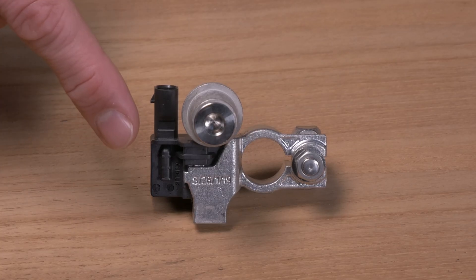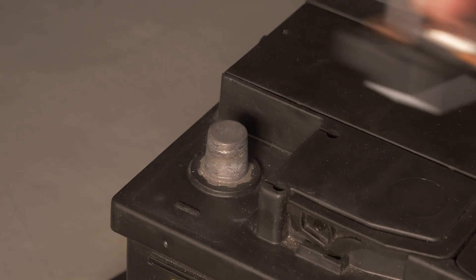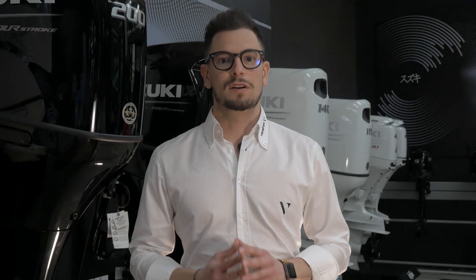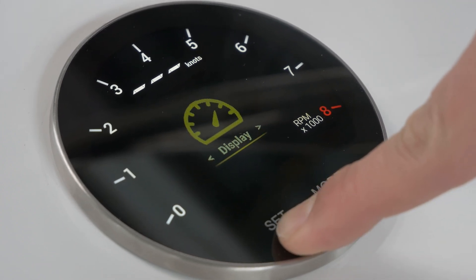Another critical component of the system is the intelligent battery sensor, designed to accurately and reliably monitor your energy supplies by delivering a lot of insights of your batteries such as temperature, state of charge, state of health and autonomy.